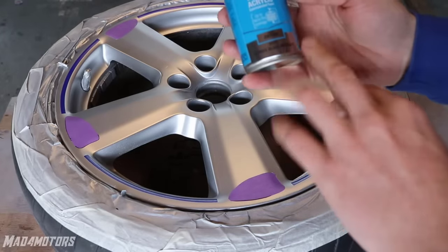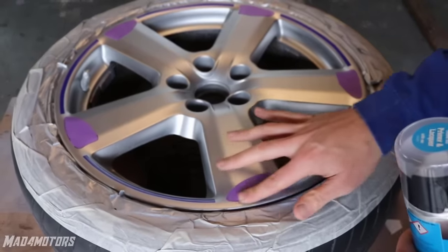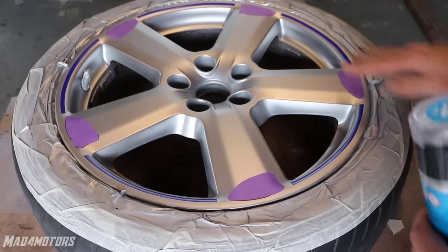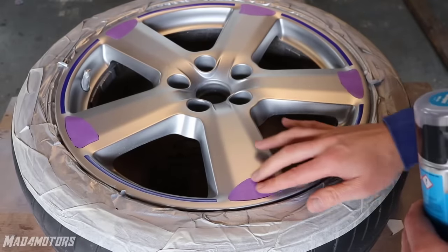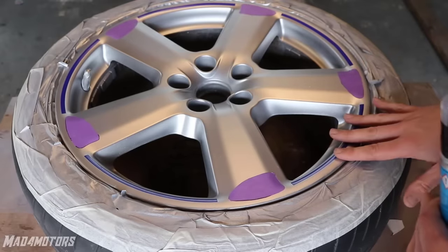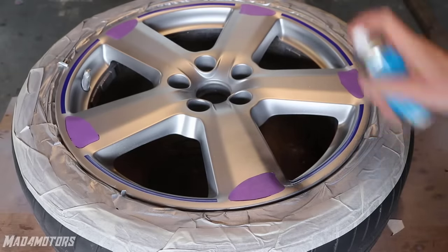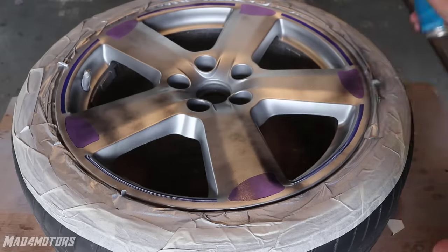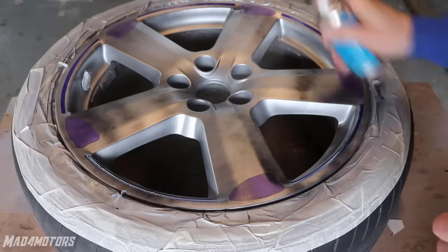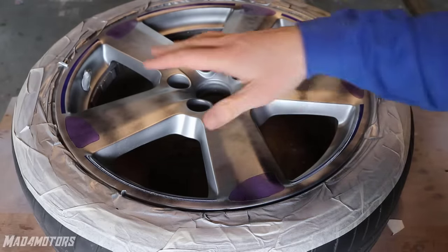So we are going to paint on the black now — this is just a standard metallic black. Before we do that we are going to go around and check all the masking and make sure it is all well pushed down with no bits sitting up. Because when we put the paint on there is a chance of it bleeding through, but the best way to avoid that is to put a really light coat first around where the masking is and then go on and put your heavier coat on after the first coat has dried. Just as a reminder, spray paint should be accompanied by a good quality respirator that feels good and fits well. That's about as much paint as I put onto our first coat — that way there is less chance of the paint bleeding through underneath the masking tape.